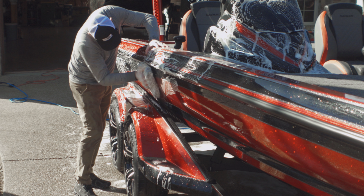Started out taking a gloss reading with the gloss meter I use, and an average new boat from the factory averages about 83, anywhere from 82 to 88 on the gloss meter. And after polishing and doing 2 coats of Glidecoat Pro Marine, I was getting about a 95 average at the end.